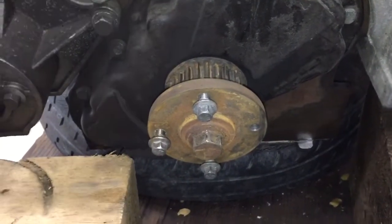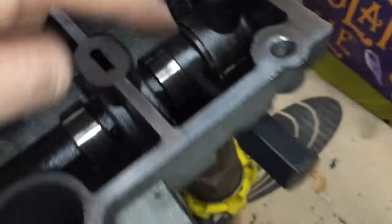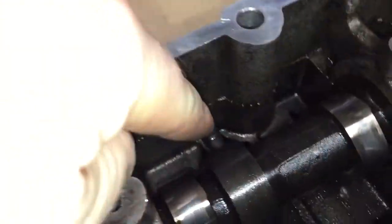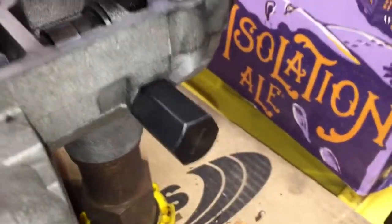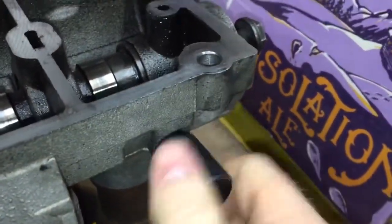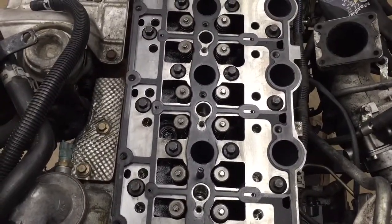Over here, you see I've got my intake exhaust pin in — that's all screwed in tight — and I have my exhaust timing pin in. So I've timed the crank and I've timed the two cams. These things are exactly where they need to be. Basically you should just run in and out by hand when you have them aligned perfectly, but that usually doesn't happen with the belts on it. So I'm about ready to drop this in. I'll set those rockers in place and then drop on the intake manifold and torque it down.